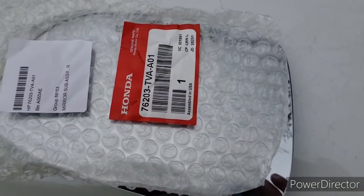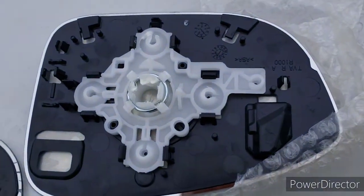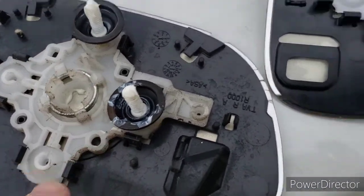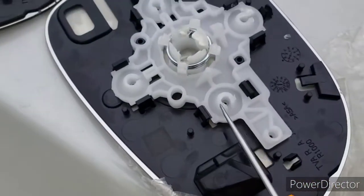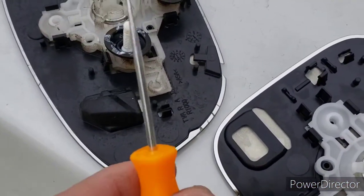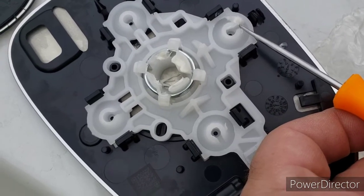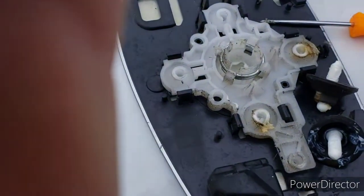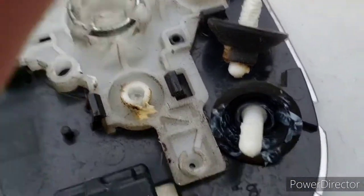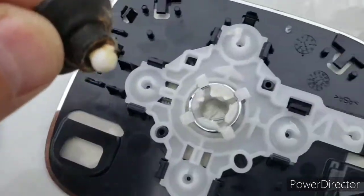Here's the new part number that I'm going to be putting in, and here's the old broken part. To get these little fasteners out of their sockets, there's a little channel right here. I'm going to get this little needle poker inside of there and pop it up. Same way on this side — there's a little channel back here and the little fasteners pop right out. You just have to get underneath the ball and put a little pressure underneath it and it will pop right up in the air.